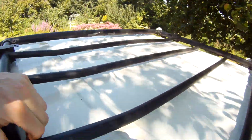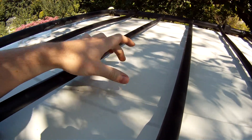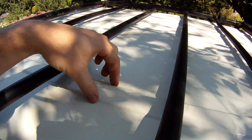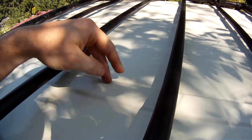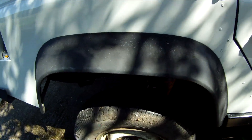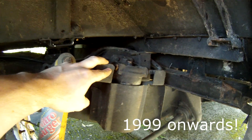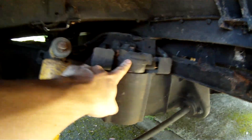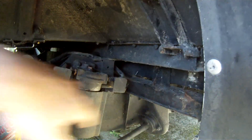The roof has got the later ribbed roof on it. I'm not entirely sure of the exact date - something tells me it's 2004, maybe 2002 was the change. You've got the ribbed roof which you get on all Pumas and later TD5s - essentially one big piece riveted in. Whereas before it was a side bit, a centre bit, and another side bit, and they do tend to leak over time. One thing I just noticed down here is the fuel sedimenter. You'll see this on 2002 onwards - 300TDIs all had fuel sedimenters where the TD5 fuel filter would go. Same cover arrangement but only two pipes - they come in and out of the front, one curls around and one goes off to the engine.